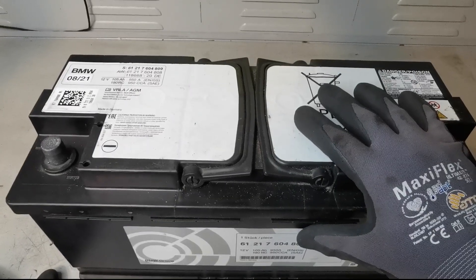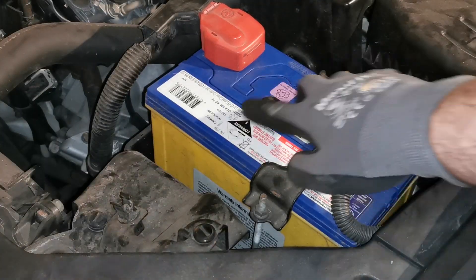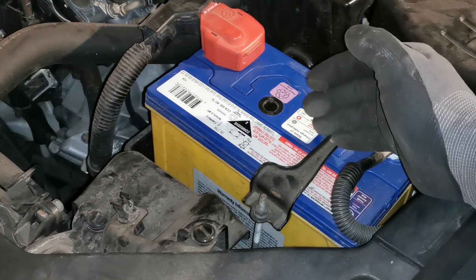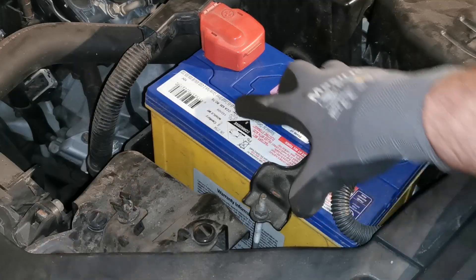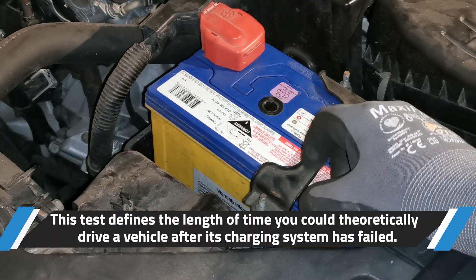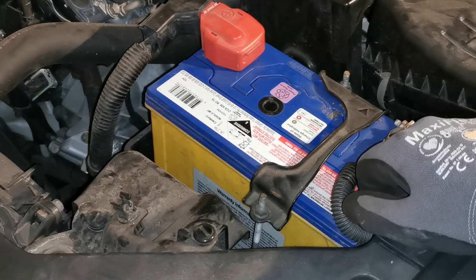If you have a battery you're looking at, make sure the style of battery is the correct one for your vehicle. You might be asking why you need to know these numbers. Batteries are very temperature-sensitive, so if you live in a cold climate or are going into winter, cold cranking amps is important - the higher the rating, the better the battery performs in cold weather. Reserve capacity is useful if your alternator stops charging, showing how long it can power your electrical system before fully discharging. Remember, a battery is a storage device fed by the alternator, and having that reserve capacity should the alternator fail will allow you to reach a safe destination.